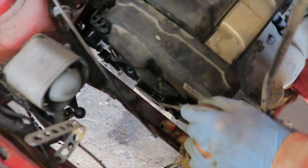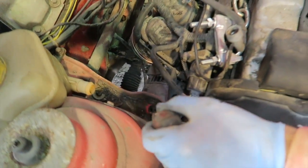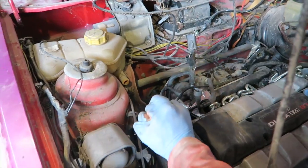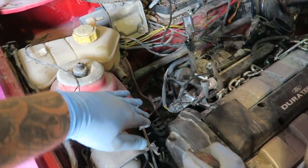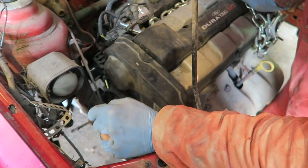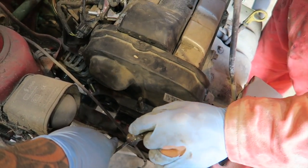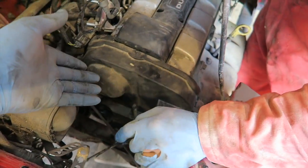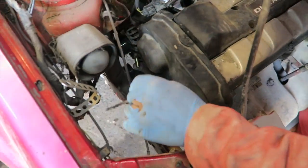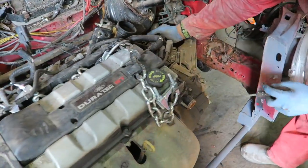So gap down here, not bad. That is the gap here. That is the original engine mount, so we'll lock that off anyway. We'll be cutting that so there's enough space, and the mount will then go there. We're going to make something nice here. So that sits onto that. Your original Focus mount here and then onto the Fiesta there. So there's enough space for it there. It's quite simple really. This will plate all this up nice, make that look nice, structurally nice.